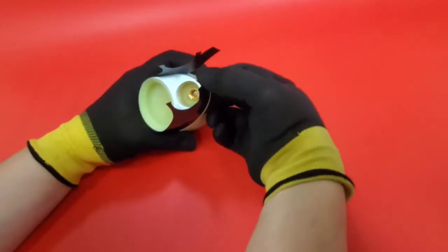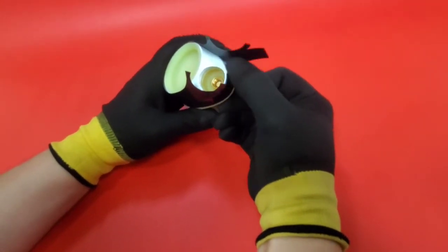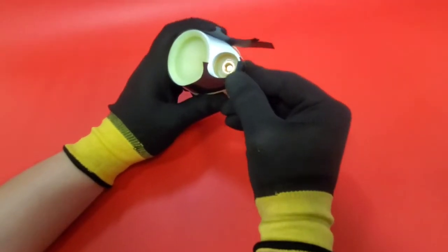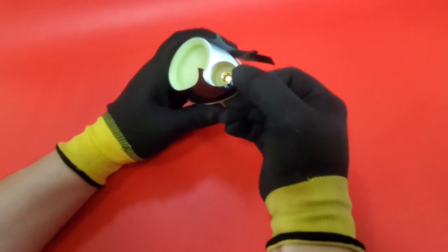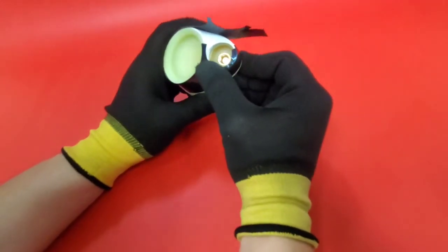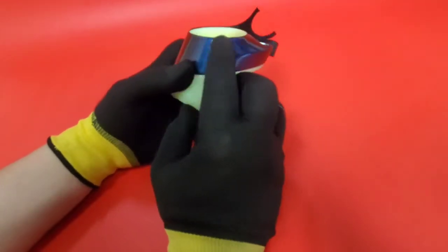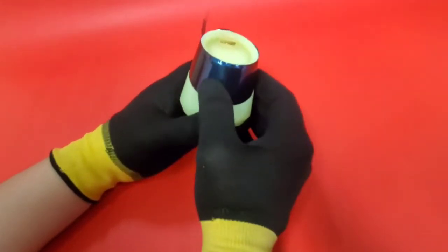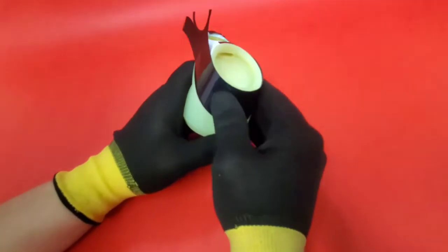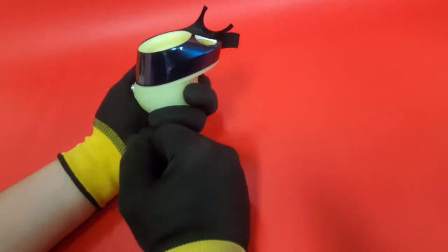Now, this top portion here, we're going to want to seal that first. Good pressure. And now this top flap over top of it. Again, with real nice, good pressure there. Now, put down this flap, and you can see we have our excess here along the top. We're going to use a heat gun or a hair dryer to get that into the creases. I'm going to go ahead and work this left side here, and we'll see you back with the heat gun.